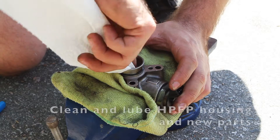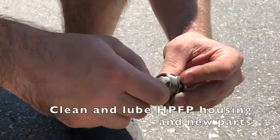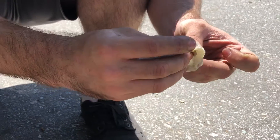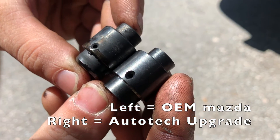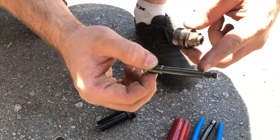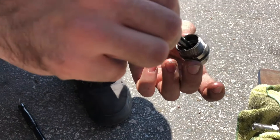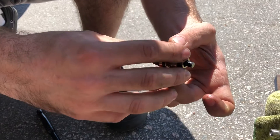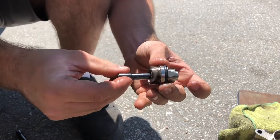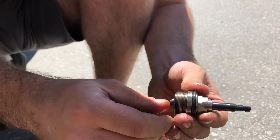What we found worked best is to stick your fingernail in the little cap and the piston will come right out. Then you give the spring a little pull and your 18mm will fit on there no problem. It is really tight, so it's good to have a friend holding the vice — and once you've cracked it, she just comes right out.